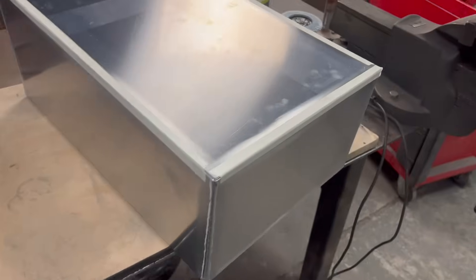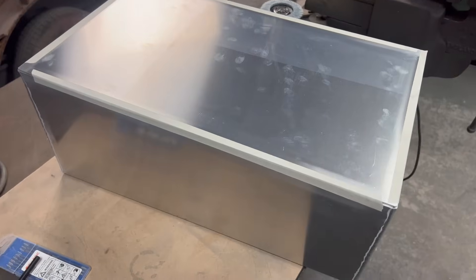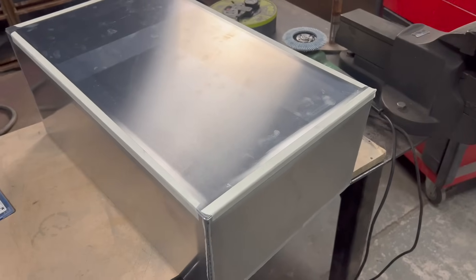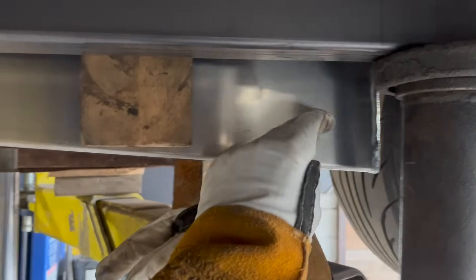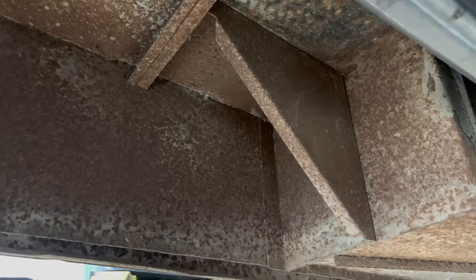Before I close these fuel tanks up and weld the lid on, I'm actually going to put them in the vehicle where they need to sit to work out where the inlet needs to go, the outlets, and the return. My sender is in the shallow end, so essentially I've got a nominal reserve from that difference — that was my thinking. If I can also use that to facilitate the link pipe between tanks, then we're on to a winner. For now I'll cut this bracket out so I can get the other tank in and start measuring up for pipe.